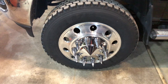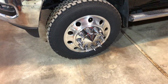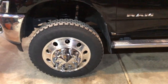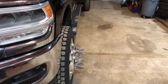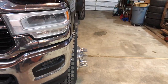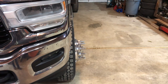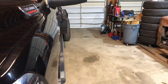The adapters are 8-on-200 by 10-on-285.75, which is the semi truck 10-lug pattern. They're going to run inch-and-a-half thick — that's the one I went with. You can get them in steel or cast iron, which are only going to be about 1 inch thick. By thick I mean how much offset you're going to get. I went with the inch-and-a-half aluminum ones because they were much lighter and billet aluminum, which means they still hold their strength.